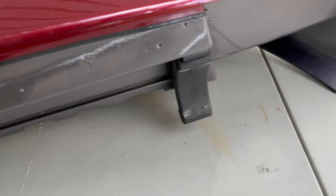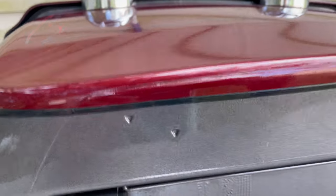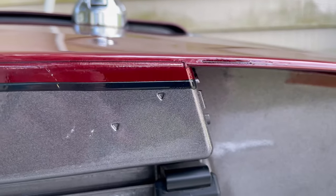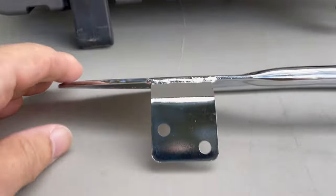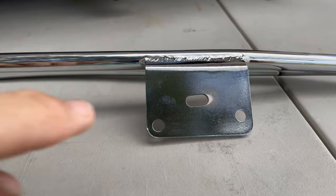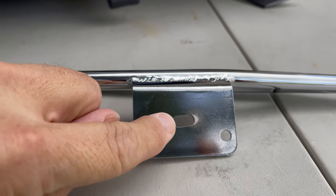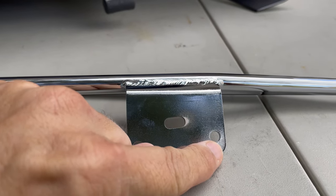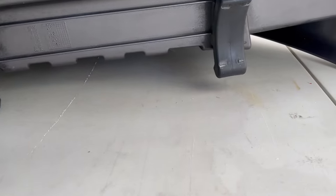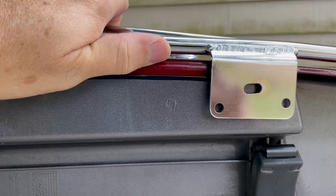As far as drilling the holes on the bottom of the saddlebag, there are these two little triangular pits here and over here — that's where you're going to drill your holes. These two holes and this hole and this hole will line up with the ones you drilled. The far right one won't be used. As you can see when I put the rail up on here, it will be lifted off slightly from the saddlebag.